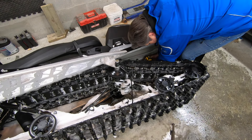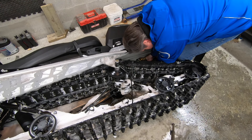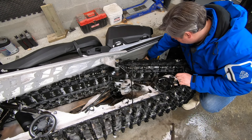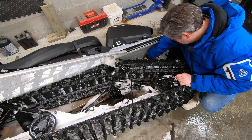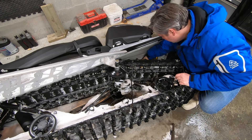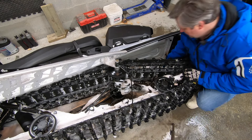With the machine laying on its right side, I have easy access to install the right side hanger. I position the right side hanger just behind my 335 millimeter mark and use a 5 millimeter drill bit to mark the two holes to be drilled in the aluminum tunnel. With the holes marked and the hanger out of the way, I can now drill my two 5 millimeter mounting holes. The holes must be drilled through the aluminum tunnel and through the inner wall of the bumper, but must not be drilled through the outer wall of the bumper. With rivets inserted in the hanger, I install the right side hanger by inserting the rivets into the two 5 millimeter holes. Using a rivet gun, I pop both rivets and my right side hanger is now permanently installed.